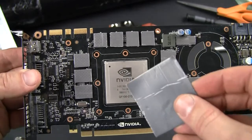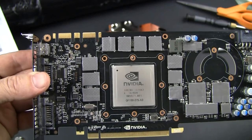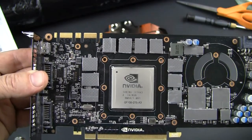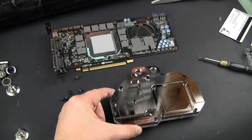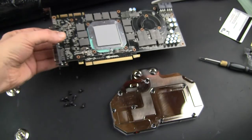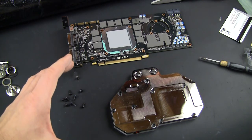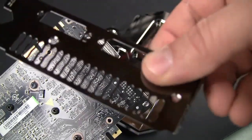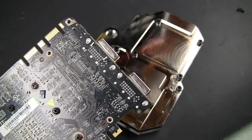What's next is to apply thermal paste on the main chip and spread it across using whatever method you prefer — I use a credit card to spread it across the chip. Everything is ready: standoffs on the block, thermal pads in place, thermal grease applied to the GPU main chip. All that's left is to lower the card onto the block, line it up, and screw it down with the provided screws. Note that you will likely need to remove the bracket beforehand, because otherwise it will be in the way of the block installation.